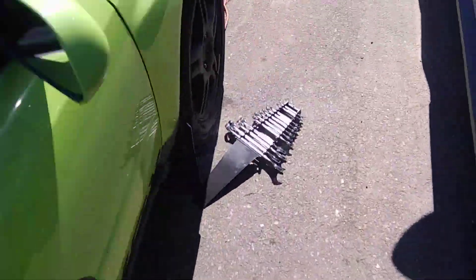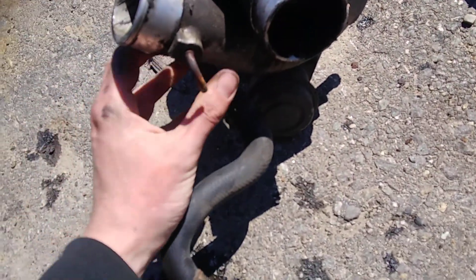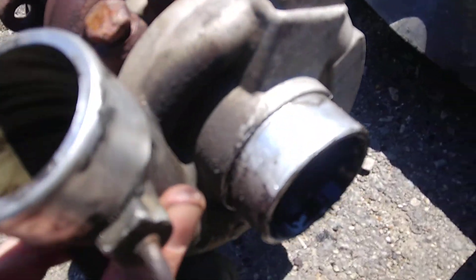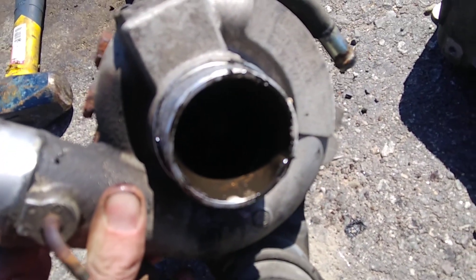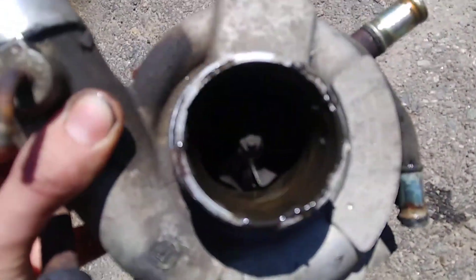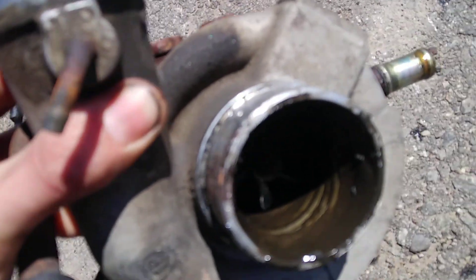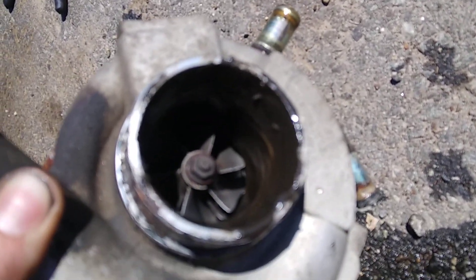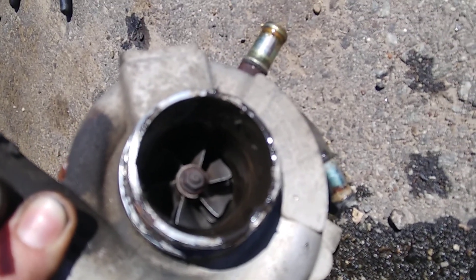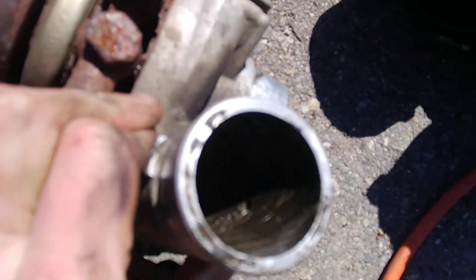Let's show you the new turbo and the old turbo. I'm sure this is probably common — there's all that thick oil and stuff inside there. The weird thing is it has no shaft play, but it looks like the fin is worn out. Because if you see — I can't get a good angle — but in the sunlight, the fins are kind of shiny on the edge, which I don't think is a good thing.